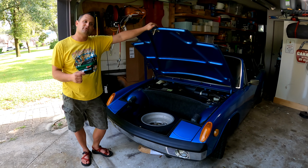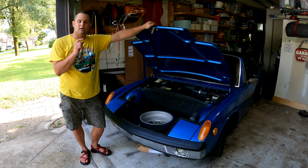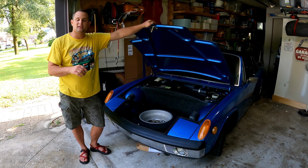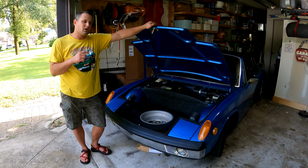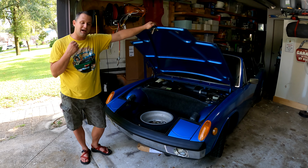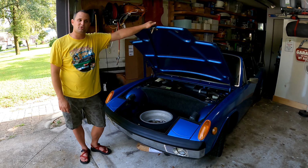Unfortunately, the wiper motor is very buried. It likely involves removing the gas tank, the fresh air box, all of the venting system for the gas tank, some of the fresh air hoses, and it's pretty far in there. So we're going to start tearing into it and try to get as much access as we can to test before we pull the half full tank out and go from there. So let's set up the time lapse and we're going to start tearing this thing.